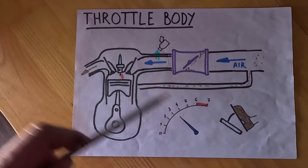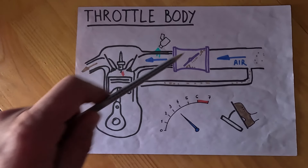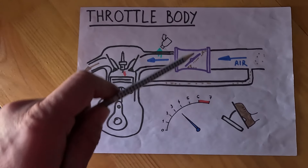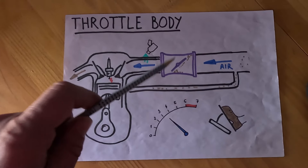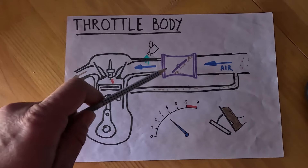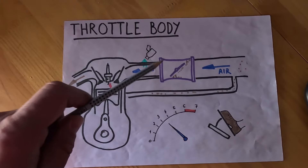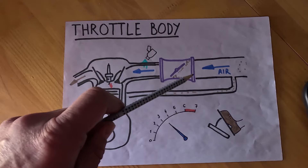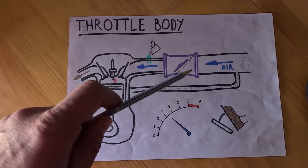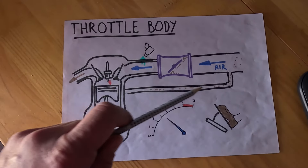In the end, let me briefly explain how the throttle body works and why it needs to be cleaned occasionally. The throttle body's job is to control the amount of air going into the engine, as this ultimately determines its speed. In terms of construction, it's no more than a short metal pipe with a plate inside. When you press the throttle pedal, this plate opens up, allowing more air to pass through; when you release the throttle, it closes. In older cars, the throttle body is mechanically operated with a cable connected directly to the throttle pedal. Most modern cars have a fly-by-wire throttle body, where an ECU-controlled stepper motor does all the mechanical work. The most common problem is oily dirt deposits that form inside the throttle body's housing, obstructing airflow and reducing its ability to control the amount of incoming air. These deposits are formed from dust in the incoming air and oily fumes coming through the engine's PCV system.